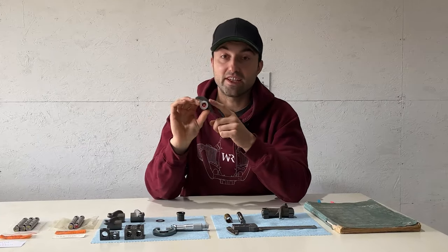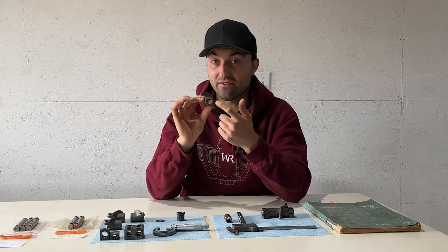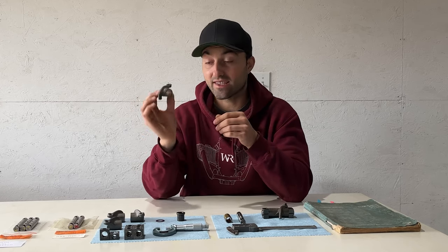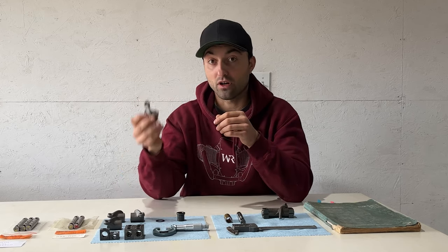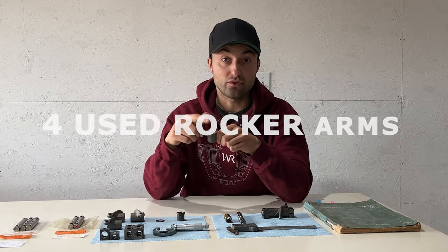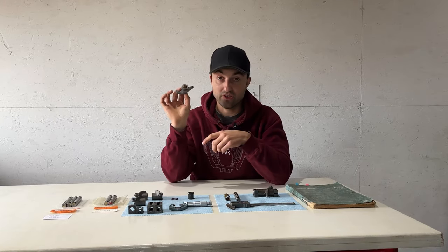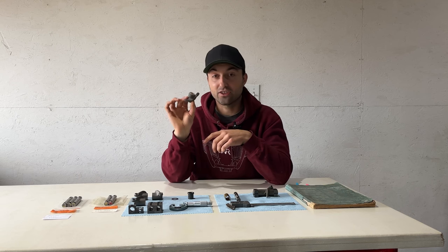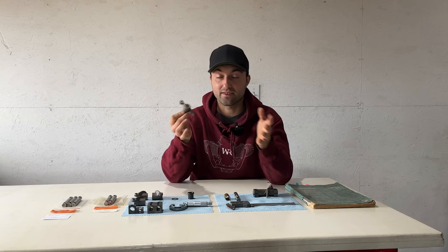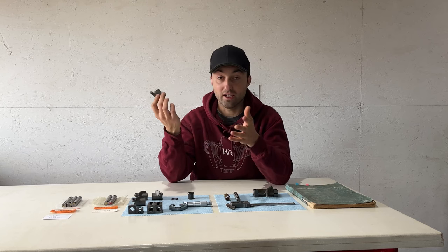So I contacted my local machine shop to see if they could bore and hone down to the size of 14.5mm — that's the inside diameter of the bushing — and they said they might just be able to do that. We discussed the assembly and I dropped off all four rocker arms to have them custom make brand new bushings for the used rocker arms I already had. Exactly one month later they got the job done. It took a little longer because they're usually set up for pistons and cylinders, so this was a custom job, but they got it done.